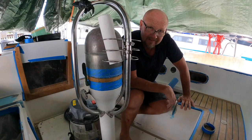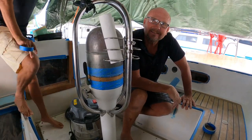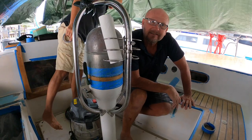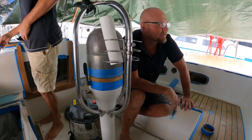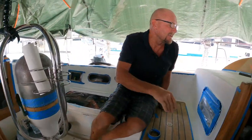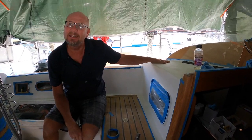Yeah. What stage are you up to? You started painting, eyeballed in places. And that's like a primer that then fills in all the little imperfections, and then we can sand that back and get a smooth finish. We've already taken out the tread, and you can see up there that we've smoothed that out. So now the lump that used to be there is gone.